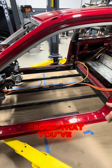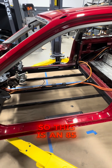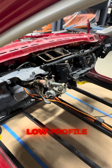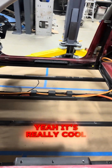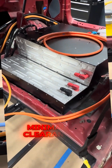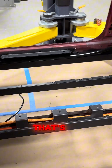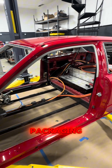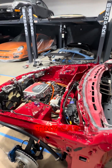This is a custom-made floor that you've obviously put together, and this is where the batteries are going to go. So this is an 85-kilowatt pack using Tesla modules. I chose those because they were super low-profile and I can actually fit them into the floor of this car. You can see how minimal the clearance is between the seat rail and where the batteries are going to go — that's a pretty slim-profile design. It really helps with packaging. It's a big pack, 85 kilowatts — a lot to cram into this tiny car.